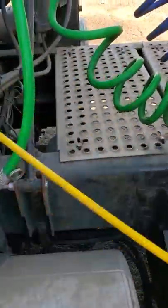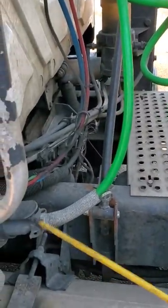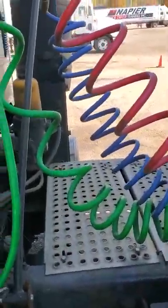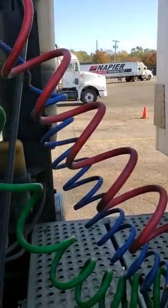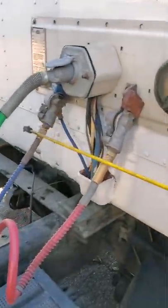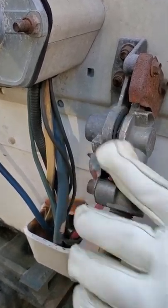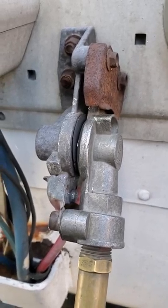Electrical line is secured to the tractor and to the trailer. It's not cut or frayed. No exposed wires and the latches are present. The airlines are secured from the tractor to the back of the trailer. The airlines are not cracked. They're not leaking. They're secure with the glad hands, which are not broke or missing. The rubber grommets are intact — they're not dry rotted and they're not missing.